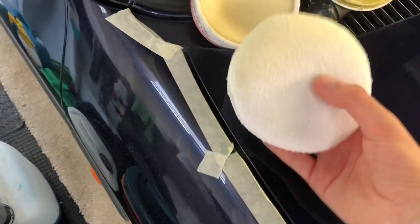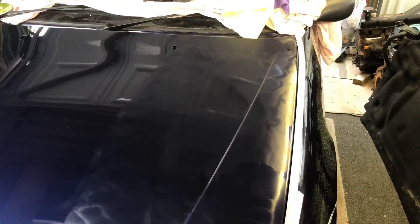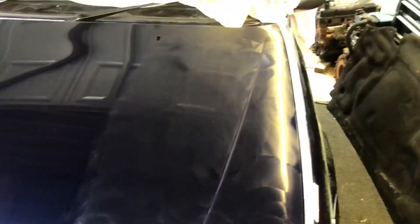Applying wax isn't that hard at all. So what you've got is your foam applicator — dip it in there. Wax is hard so I've got quite a lot on there. Whack it on and what you want to do — this is the only time you actually want to make swirls on the car — just go around like that and make swirls. I've waxed the last third and what you want to do is just wait until it goes a bit white and nearly dries up, then get a brand new microfiber and buff it off. For people wondering why you're putting more stuff on it — you do need to because I've just compounded the paintwork. That means I've taken a layer off of it and now it's not protected, so putting the wax on protects the paint.